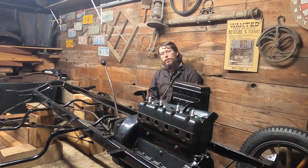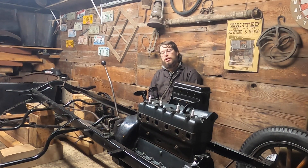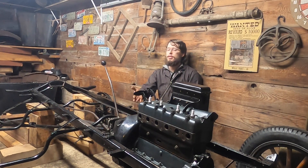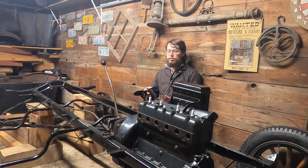I also wanted to point out the unique design solutions that Ford used in the period. If you look at this car today you'd say it's not much, but for 1908 the approaches to the design were really amazing. For instance, the gearbox is a two-speed planetary gear transmission, very similar to modern transmissions in that it has bands like automatic transmissions. Some people call it a manual automatic because it uses bands and planetary gears instead of actually shifting gears — no gears become unmeshed in this transmission. Ford did that because standard gearboxes of the period were very noisy.